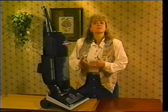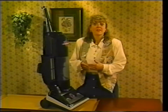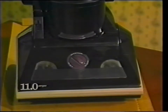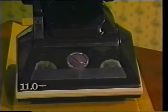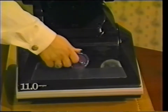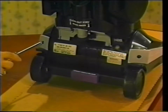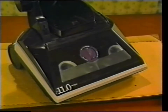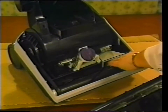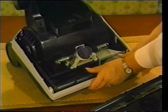Try the Phantom to see if it's working. You may have cleared the blockage without even knowing it. If not, make sure the Phantom vacuum is in the upright position once again, make sure it's unplugged, remove the collection bin, and take off the lower base cover. First, make sure the carpet height adjustment dial is in the medium or straight up and down position. Then take out these two screws located in the back of the bumper guard. Lift the cover up and off by tilting it towards the front. Then you can take a look at this inlet for a blockage. While we're here, let's clean out the carpet brush and remove any thread or dirt caught up in it.